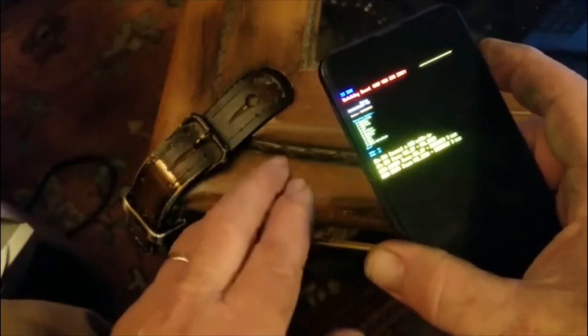That time I got to this screen, which is not the reset screen. This is basically just the watchdog reset, which does not allow you to do a factory reset. So I held down power and volume down to reboot, then held Bixby, volume up, and power again while it was rebooting, and it brought me to this screen.